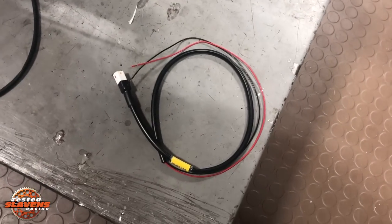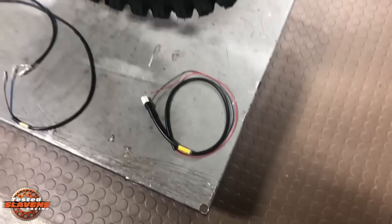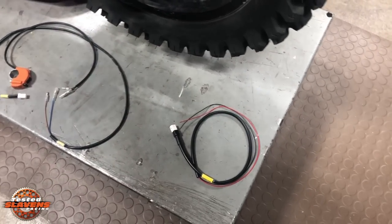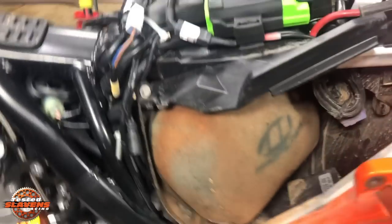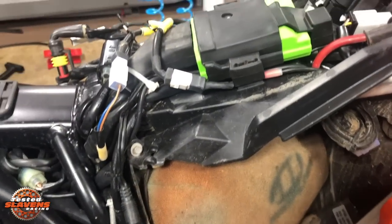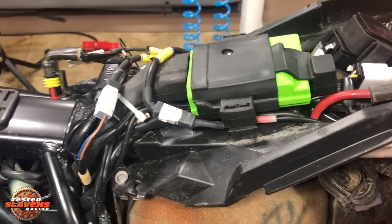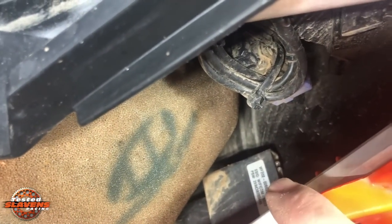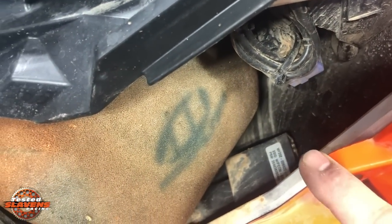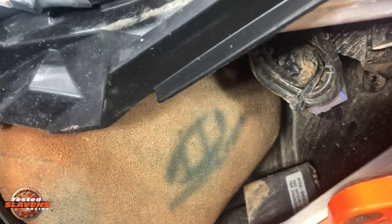This wiring harness also comes in the kit and they say to use it to set the TPS, but you absolutely don't need that — it's more of an old school method and we don't use it anymore. Once you have it this far along, turn on the ignition switch. This Wi-Fi comm has two little LED lights — a green and a red. Just wait for both of those to light up, and when they do, you have a Wi-Fi signal and can connect it to your phone.